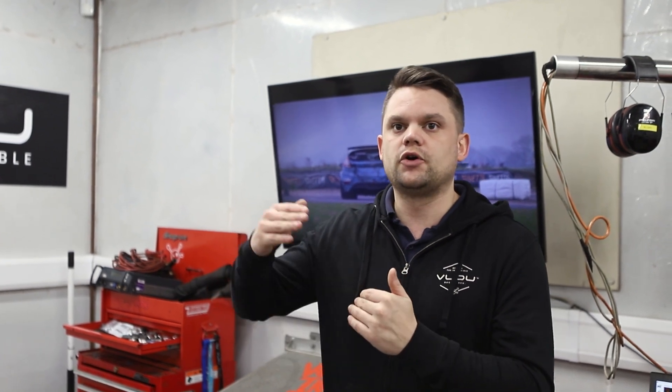The intercooler was working really efficiently over 40 seconds of absolute flat-out driving, which is fantastic. But over six back-to-back pulls we actually found it had only gone up by five degrees. To go from an ambient temperature of 8 degrees in the cell — which is very cold anyway — to only get five degrees above that is such a good result that this cooler could actually be sold as a Stage 3. People will buy it and use it on Stage 3. Our car is running to the absolute utmost we can possibly run it before going beyond what we'd give to a customer, so for us to see those results means that cooler could quite easily be used as Stage 3 consistently, whether on track, drag strip, or on the road.